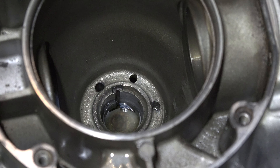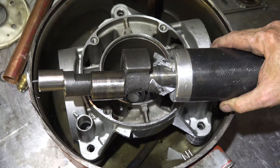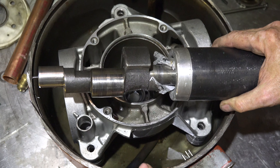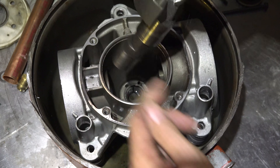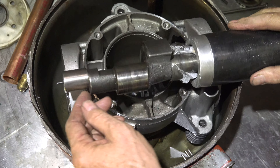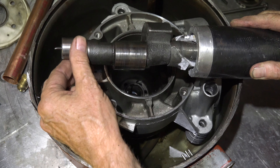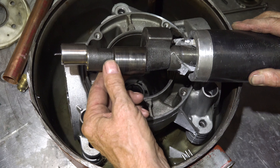I've taken the crankshaft apart a little bit. Looking at this crankshaft, you can see down here — this is the one that goes all the way down, fits down in like that. The bearing looks pretty good on this one; a couple of scores on it but it's still okay.